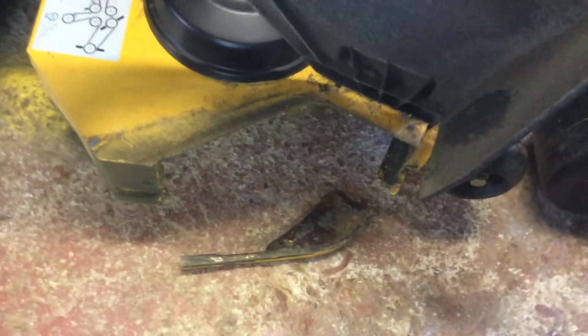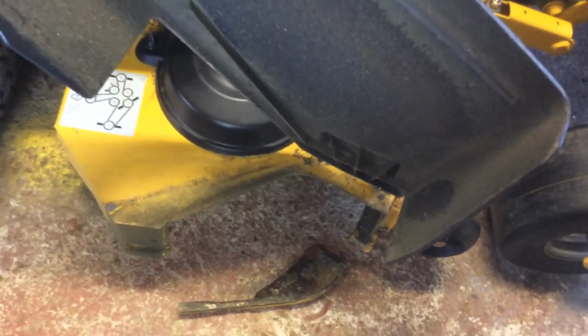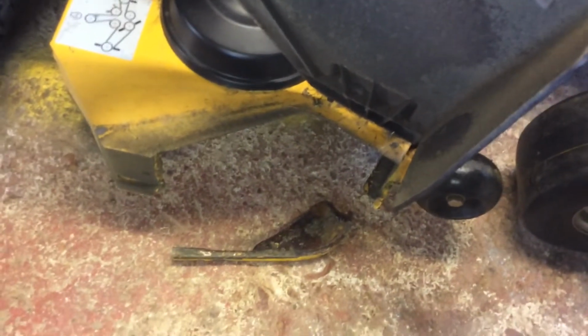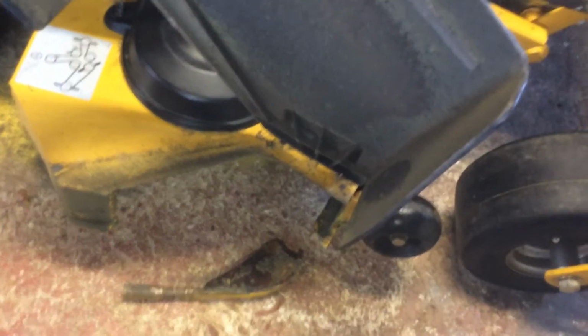And when I cut that off, I was sweeping every time I mowed. I had to use my sweeper when I got done mowing to make the yard look good, because just leaving lumps all over the yard, it looked terrible. I knew it did real good when the yard was dry, but with the dampness, oh man, it just lumped and everything else, and sometimes it would stop up. When I cut that bar off there, man, that solved my problem. I had no more lumping. Now the grass, of course, it's fall now, and I also raised my deck up a couple of notches. I was mowing a bit too low. I have done no more sweeping. The yard looks great. You don't leave no more lumps in the yard.